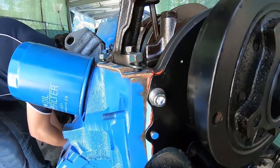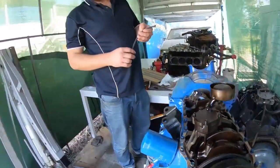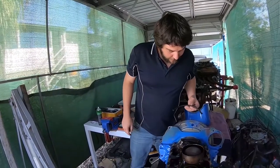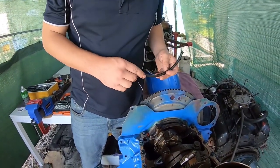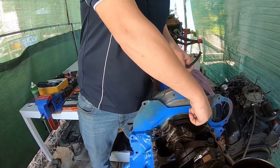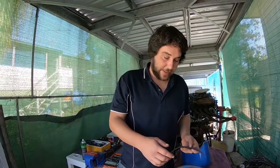Give it a quick wipe. Pay special attention — you don't want any overlap, that's perfect. If you're doing this under the car these will probably be dropping out and give you all kinds of trouble. What you can do is put a tiny dot of super glue to hold it in place if it's perfectly clean. Some guys like to put a full bead of silicone over here; I don't — I like to put my bead of silicone on the other side that sticks to the pan.